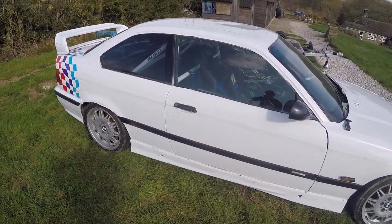Depends on preference, so Federal RSRs are good. Toyo R888s, I don't think they're as good as they are, but I haven't run them. The dedicated tyres, I'd go semi-slick as well. You have to be really serious to be on slicks, and the semi-slick gives you a bit more in the wet. To complement the tyres, definitely go for some stiff suspension.